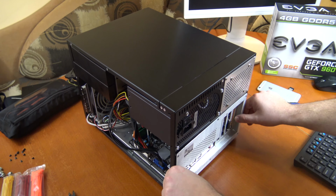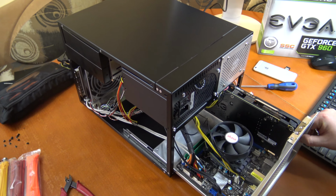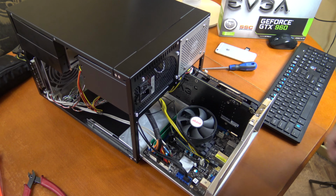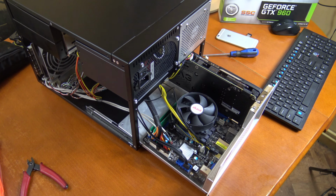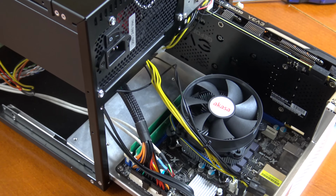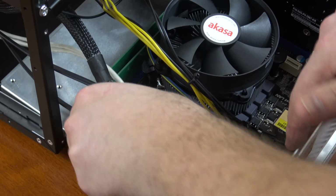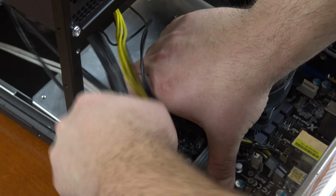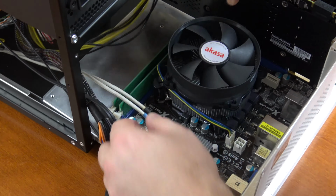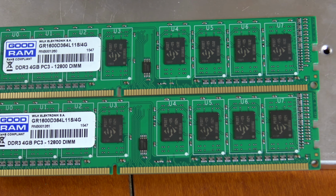The point is, all you need is an Ivy Bridge i5 and a motherboard with PCIe 3.0, and that's basically it. If your CPU is not a K part, you don't need a fancy chipset. A simple motherboard will cost you around $30. For $130 you can get a motherboard and a CPU, and that's cool. Sometimes it will take some time to find the right part if you are buying something used, but just be patient.